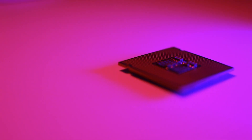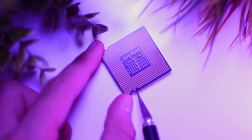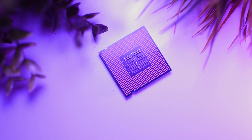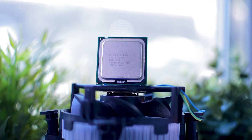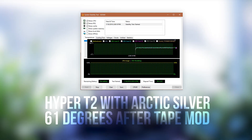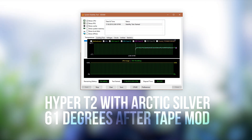For a small amount of tape, this mod can easily nudge some extra performance out of your older hardware if it's compatible. The good news is it's completely harmless if you want to give it a go, as you only need to remove two strips of tape to revert it back to the original speeds. Now all that's left is to test the impact on CPU temperatures. Firing up AIDA64, the CPU ran at about 54 degrees before the mod and increased to 61 degrees with the mod applied — so overall temperatures stayed within reason the whole time.